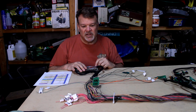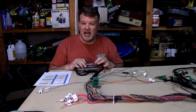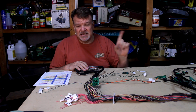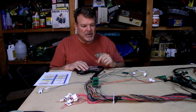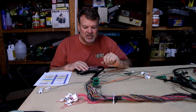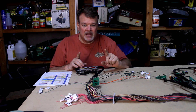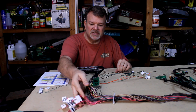The gray wire is back in pin 41 — that's solved. The purple wire is routed in and plugged into blue pin 42. I'm going to change how it exits though; I don't want it exiting the harness on the other end, so I'll clip that purple wire off and run it to exit the harness at this point along with the other wires. I'll change the direction of all three of those wires. Next I'm going to show you a diagram of how this whole thing is going to look, and then we're going to start soldering on the pink wires.